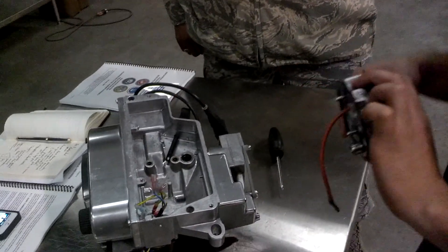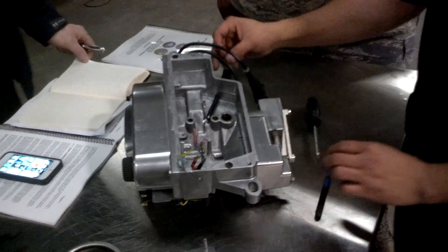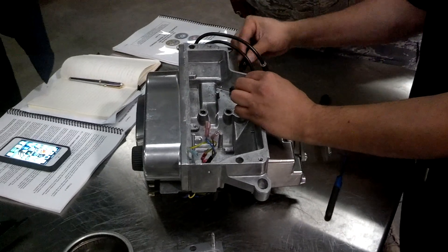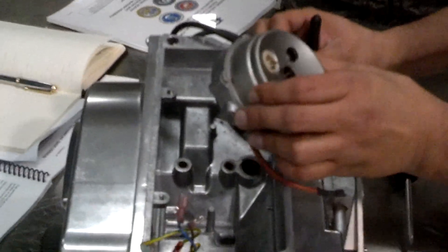If not, it will go into lockout mode with the primary control box. To replace the photocell, you simply slide it right off of the photocell base. There is something very important on this photocell that you have to make sure you have — this spacer. If you don't have that spacer, the photocell will go past the position that it's supposed to be behind the atomizing chamber.